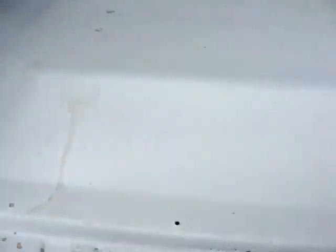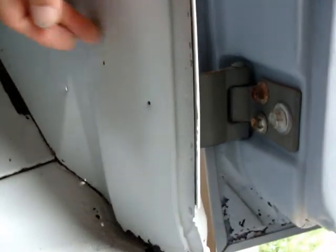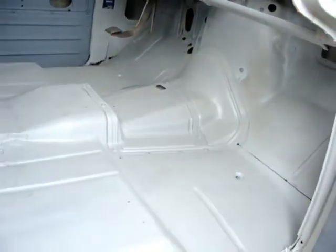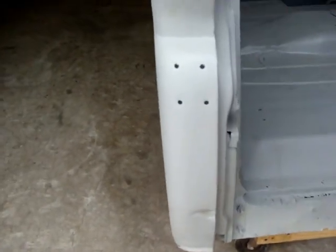Needs inner rockers. This one ain't bad on this side, but I'll still order two inner rockers. And inside this kick panel, there's a patch that comes up here, so I'll probably cut it somewhere along in this area and patch that. A little bit on the floor there — just the lower part is rusted out, which it could be fixed.